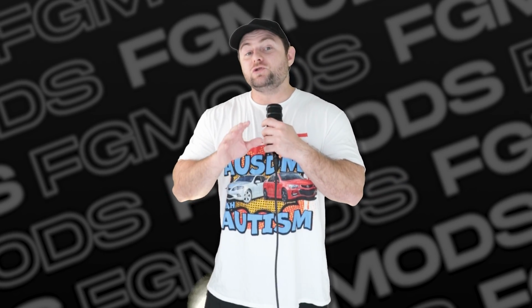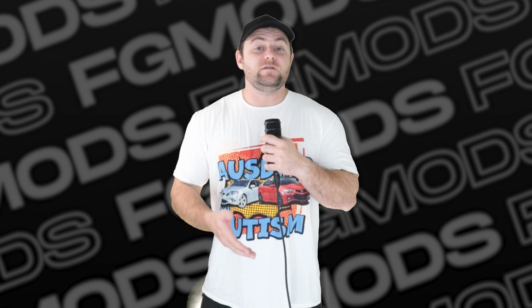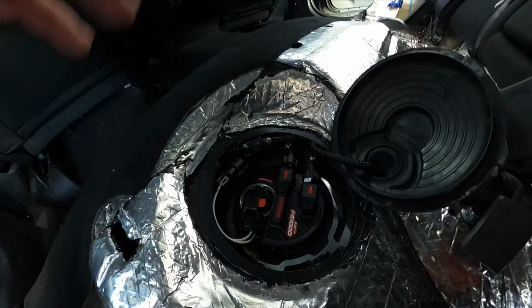Now, if I had two fuel pumps or even just one fuel pump that draws more current, it would be a different story, and I would have to replace the factory wiring with a better, bigger mil-spec harness, which is exactly what Aftermarket Industries does in their setups that are to support higher power configurations.